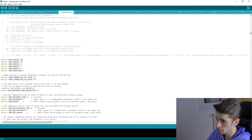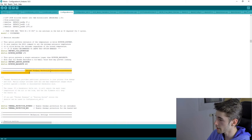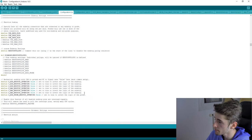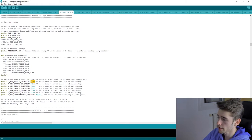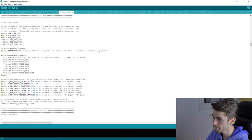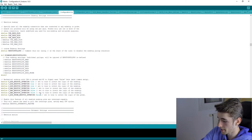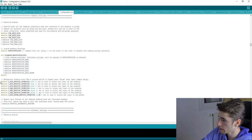There's also thermal runaway protection — I strongly recommend keeping it enabled. It's a critical safety feature. You need to set 'true' instead of 'false' on those lines — the first three lines and the last one for the Z endstop. If you disable it, your printer can behave dangerously. I've had bad experiences with it disabled, so please leave it on.